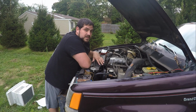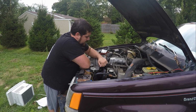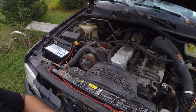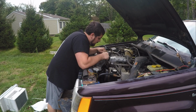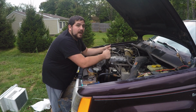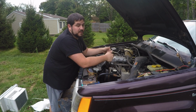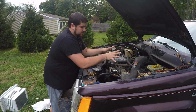It wasn't too bad. The install of the HD fan clutch wasn't that hard. Some people remove the fan shroud. I've got my own little custom hack here. I'll bring you a little closer. I'm sure you guys saw this before, but if you look there, I had cut my fan shroud so it could take out the fan very easily. With that, you need a flathead, and we've gone over this in a junkyard video, and a ratcheting wrench. I made my own custom ratcheting wrench. I ground all the edges down on a normal ratcheting wrench so it was nice and thin. It can fit right on each bolt, and it's a 13 millimeter. Once you pop that off, it's another set of 13 to get the fan off, and you put it all back together in reverse. Real short and simple.